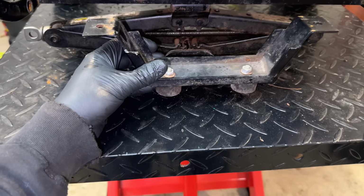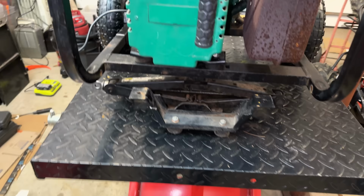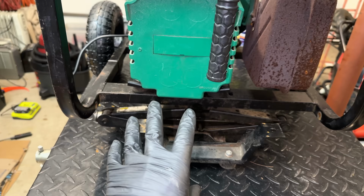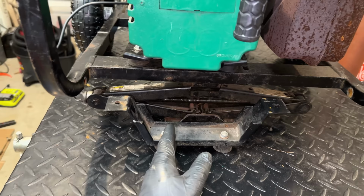The center of this rail is right about there. So visually, this is where the foot should go. Functionally, that's not the best spot. The majority of the weight of this machine is right here in the stator, and if you follow this down, it's actually on the left side of this foot. So this machine is a lot more likely to roll to the left, especially when transporting it, if I put the foot right there. Now, some manufacturers, not many, do favor one side to help stabilize things. So that's what I'm going to do.